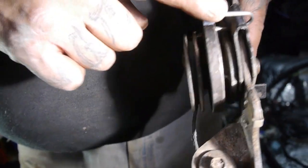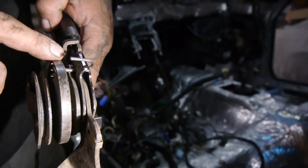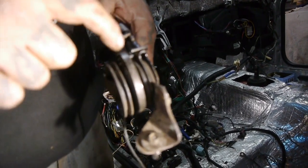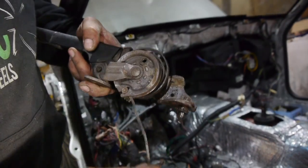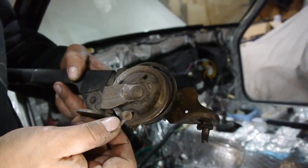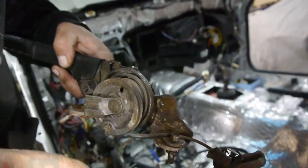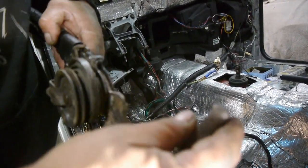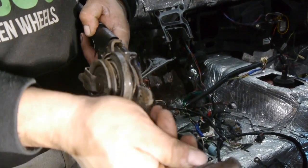Now the reason this comes like this is because you don't want to uncoil the spring right here. So it sits like that. When you get the lever, you're going to install everything, and this pin should be the last thing you pull, because once you pull it, it's going to uncoil. This is how you get it when you buy it. So you're able to have it ready, run your cable underneath, and get it set up. Once you're done, you pull the pin, and it'll taut the line. It'll bring whatever slack back to the top. I'll pull it so you guys know what I'm talking about.